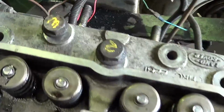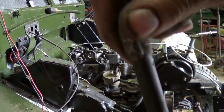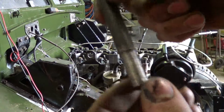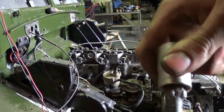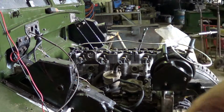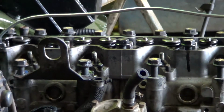goes in there. Now, before you take your cylinder head off, mark up all the numbers of the bolts, so it's so much simpler to torque them back down. Just topped it to save some time. Make one of these up. This one's getting worn out from chopping down. Stick your socket on there, put that in your drill, set to the lowest torque setting, and just tighten them up ready for torquing now.